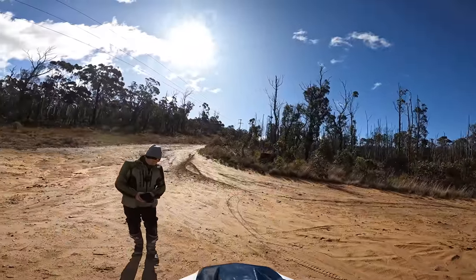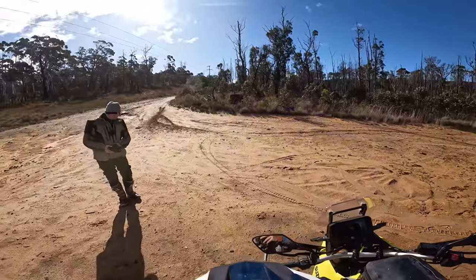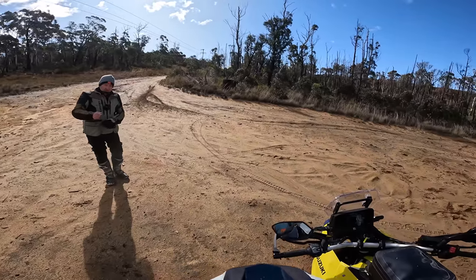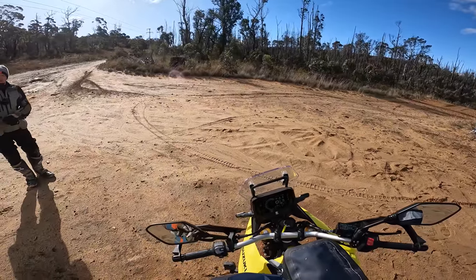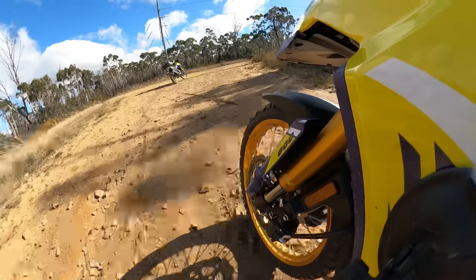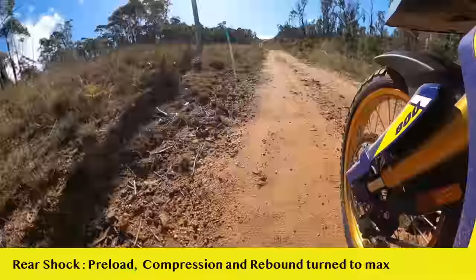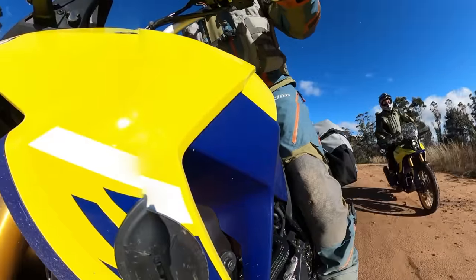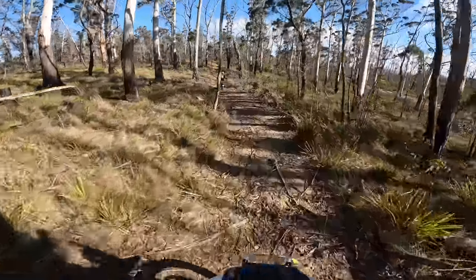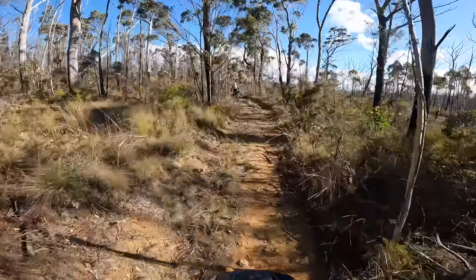Because of the talkiness and playfulness of this engine you can ride light very effectively on it — it has such clean throttle response, just one-eighth throttle on and off, then crank it hard and it responds cleanly. After the afternoon getting to know the suspension and its limits, we cranked up the rear shock preload and set compression and rebound damping to max for our style. These settings worked well for the remainder of the adventure. For the small percentage of riders who want to push this bike hard, a suspension specialist for springs and valve work will be rewarded — the handling on dirt is excellent and the engine is ideally suited to it.